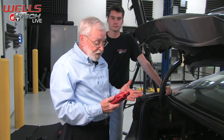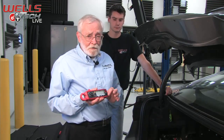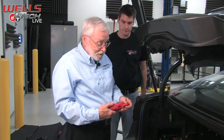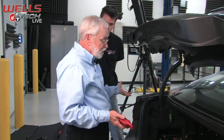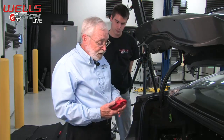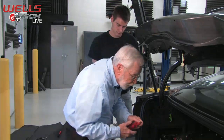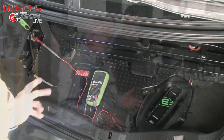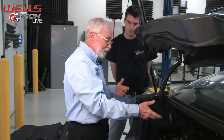Now you take the meter, and since these are not Cat 3, there's no reason for it to be Cat 3, because it's inductive. Make sure the system is off. Yep, I verified that when I looked at the voltmeter. And then put the amp clamp around the orange cable that feeds the DC to DC converter. Now you could turn the system back on, and we could observe the amp clamp and see if there's current showing up on the amp clamp.